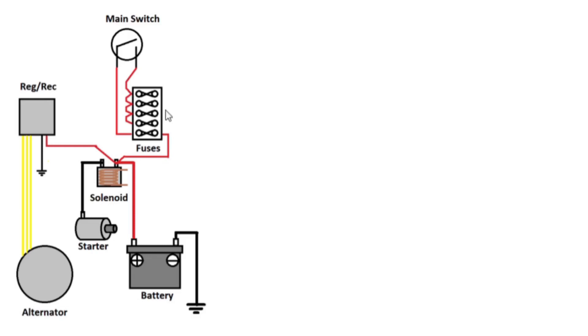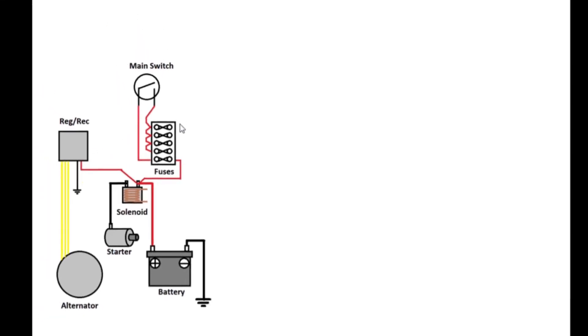So that means this side of the fuse box we've now got four live terminals to come off of. The first one we use is the ignition fuse. We connect it to the low tension side of the solenoid via a push-to-make switch. You can put that switch in the ground side, but I don't like that because if that wire gets a short, the starter motor will just keep running. If the switch is in the positive feed side, a short will blow the fuse rather than leaving the starter motor running continuously.